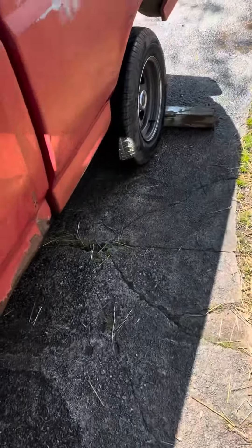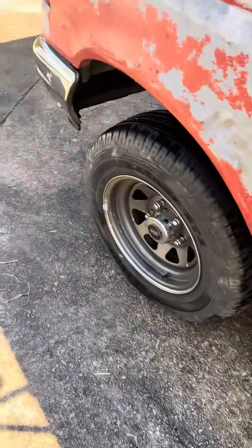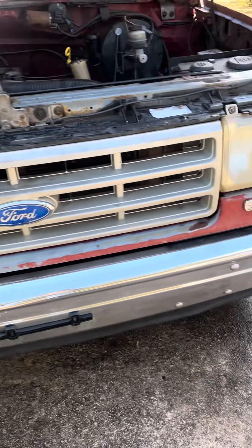Going to the back — you're not gonna be able to run the stock tank. I had a single-tank 19-gallon, so I bought one brand new. I have an older truck — it was the generation before this one that were carbureted. I got a little electric fuel pump in here somewhere, like 20 bucks from RockAuto. By the way, all this stuff is from RockAuto — all the gaskets. I went through this motor. So yeah, that's my '89 carbureted F-150.